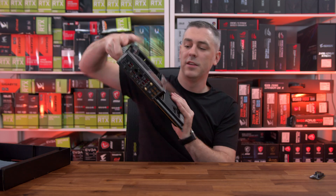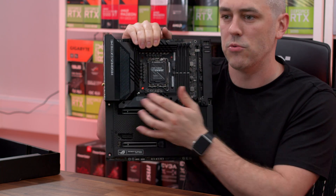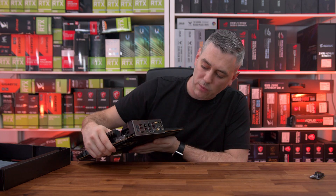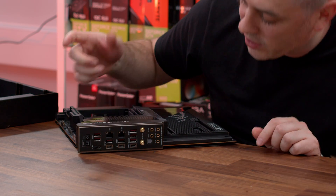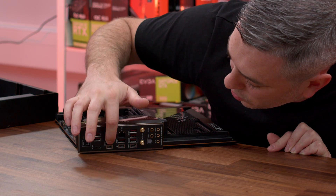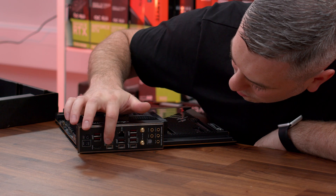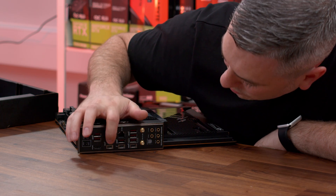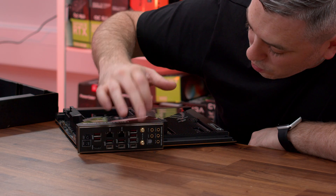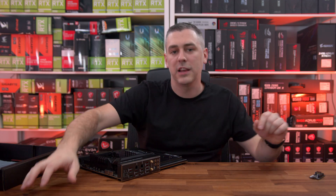As we go around past this screen, which wraps around to the rear I/O, we are greeted with so many connectors. On here we have: clear CMOS, BIOS flashback, HDMI, USB SuperSpeed 10, more USBs, 10GbE from Marvell Aquantia, 2.5G as well. There's another SuperSpeed, a USB Type-C Thunderbolt, and another Thunderbolt over here, plus a BIOS flashback USB you can use for other things. More USB ports, Wi-Fi 6E connectors, gold-plated audio connectors for our 7.1 Supreme FX audio, and an S/PDIF optical.